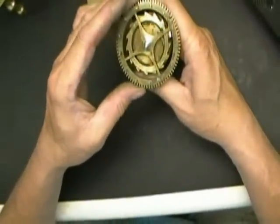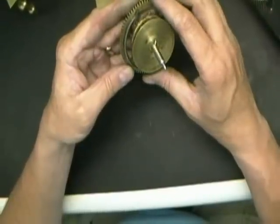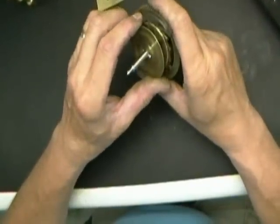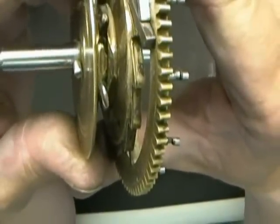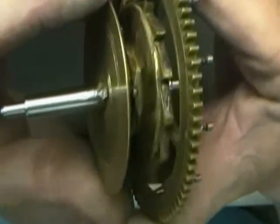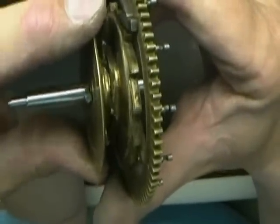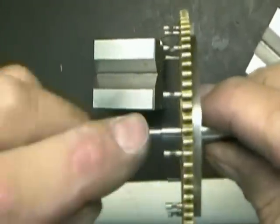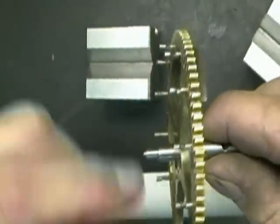This clock's got so much to do on it. I've got to repair that click — it's not really doing its job. Although it's behaving itself now, it does have an awful lot of play in it. See the pivot part? See it moving around right there? That's where it pivots. What we're going to be doing next is replacing all of these pins that are halfway worn out — I'm afraid they're going to snap.